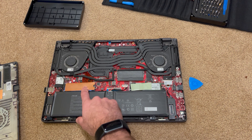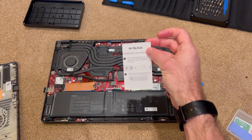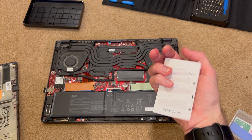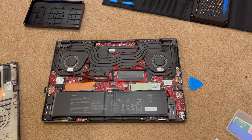I also have a copper slug — it came as a little kit. The brand is SGTK JSJ. Originally I just had the SSD in here without any heat pad or copper slug on top of it, but under load I noticed that it was getting very, very hot and was actually thermal throttling.